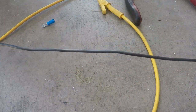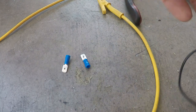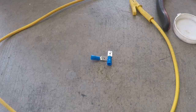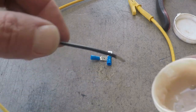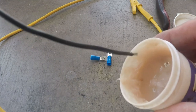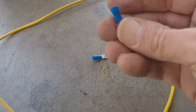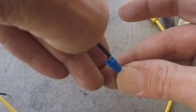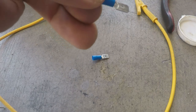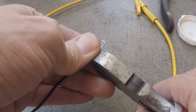Now we need to make three extension wires to go from the ground, the positive, and all the way to the ignition coil. We're going to start with just a regular wire and take two of these male connectors and solder them onto the end. Once you have the wire stripped, don't forget to put some flux on it — you always want that solder to get drawn to the wire. Stick these in here and once you get it in, just clamp it down.